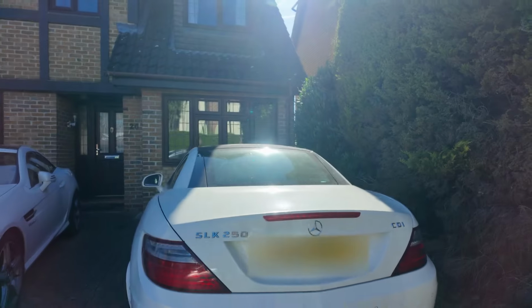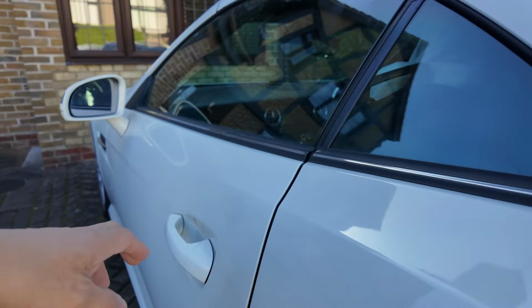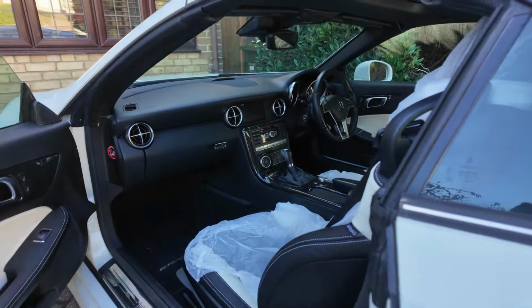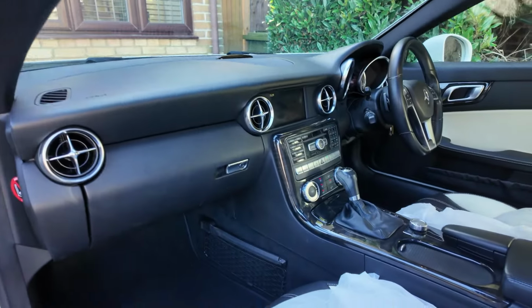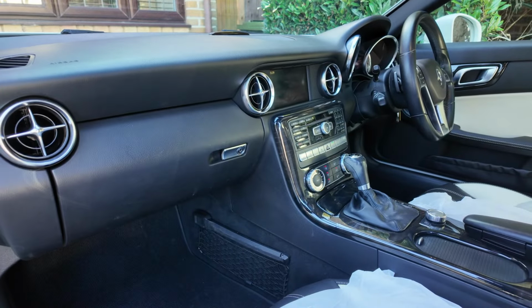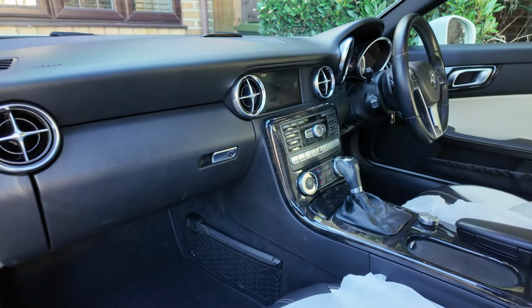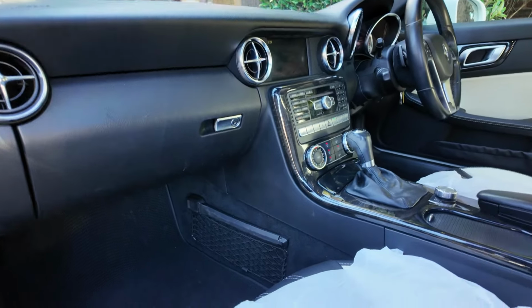Hi, back again for a quick update. So my subscriber's car, as you can see here, has been put back together. However, it's not a full fix, it's a partial fix. I'm still getting the blender flap malfunction fault code, even though earlier when I checked, the shaft for the blender flap was moving. So something in the heater box has gone awry. Could be misaligned flaps or something, but it's terminal.